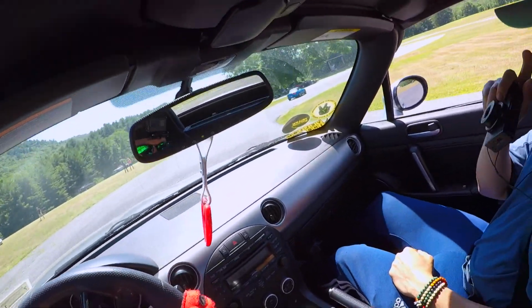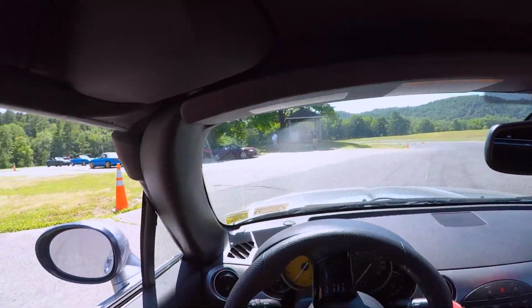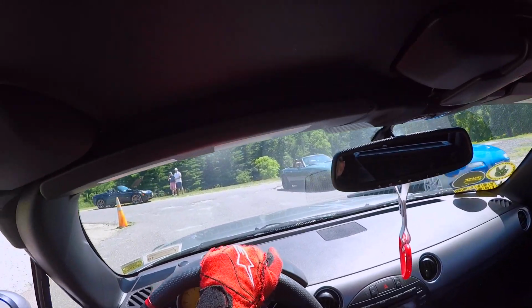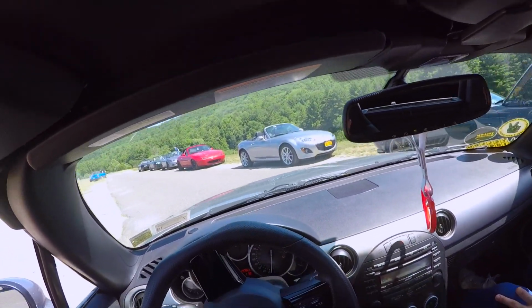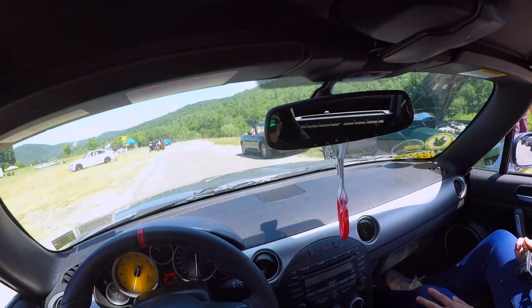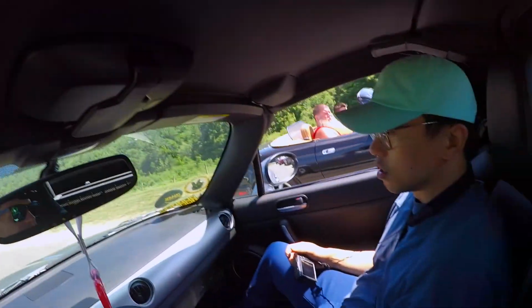So this car you have to work, I'm really using a lot of momentum because the front just wants to wash out before the rears. Yeah, I would consider realigning this. Realigning it? And trying to get some of that rear camber out. If you can do at least a half a degree lower than the front. Yeah. The problem I don't like is once you get this into an oversteer situation, it's snappier. It's snappier, yeah, you're right.